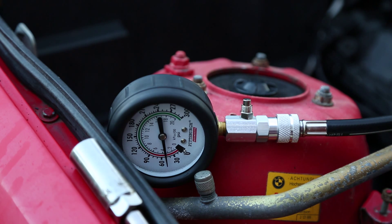As you can see, cylinder 4 is substantially lower than the rest of the cylinders. It looks like there is definitely something going on, and it probably confirms that there is something going on with the head gasket in this car.